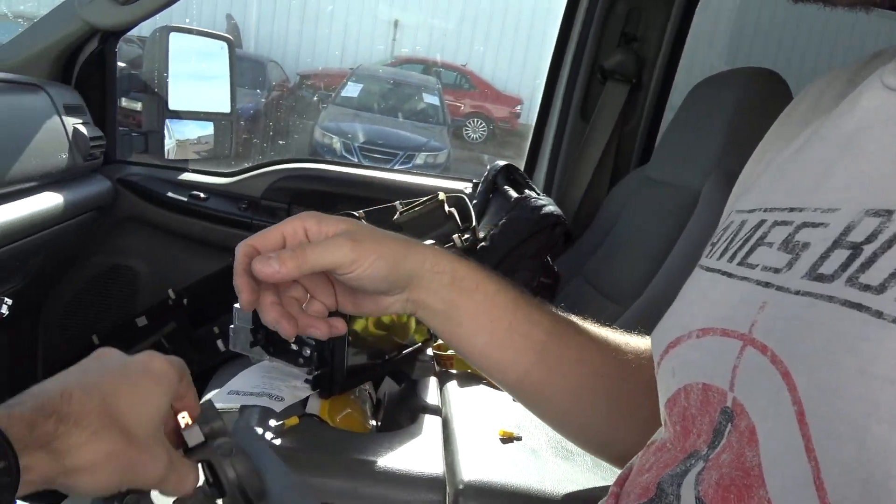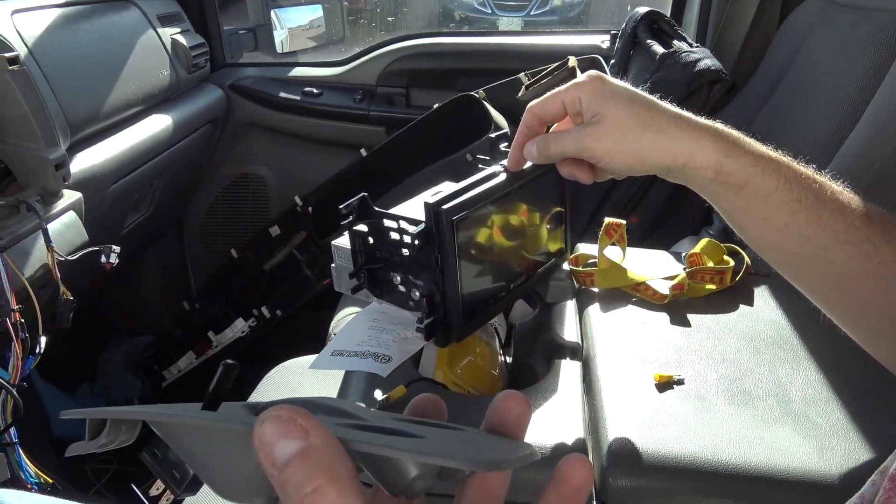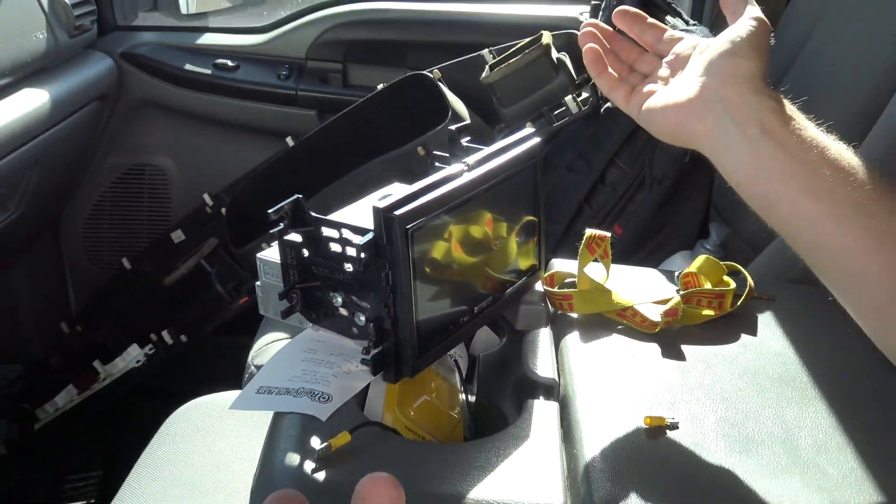So what is this? This is your parking brake, yeah? So what you used to do before was you just grounded the parking brake. But then they're like, oh, people are grounding the parking brake, so it has to have a switch. Even if you have it wired to the parking brake, you're chilling in a parking lot, you'd have to depress the parking brake and then reapply it to get everything to work. This thing literally doesn't do anything unless the parking brake is applied.